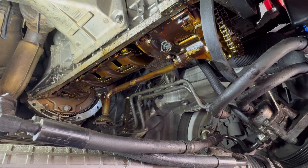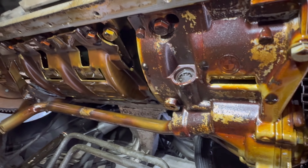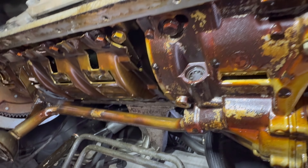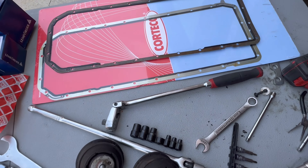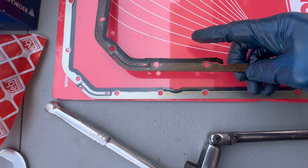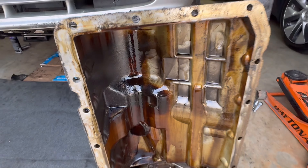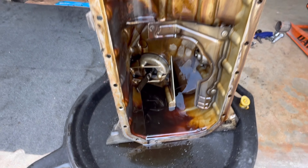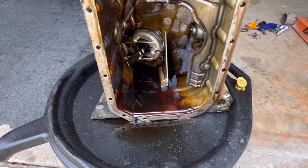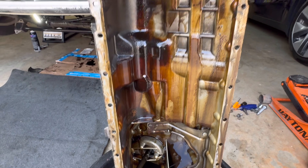Let's get the gasket out of the way and we can see the bottom end of the motor - not quite as clean as up top, but it's not crazy. We'll take a look inside the oil pan. Here's the old gasket - it's definitely old, all this stuff is turning to plastic when it should be rubber, and a lot of it is missing. Here you can see the inside - just normal staining. I don't see any issues, there's no glitter or anything in the oil. So I'm going to degrease both sides and then put the oil level sensor on, put our gasket on, and get ready for reinstallation.